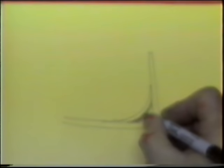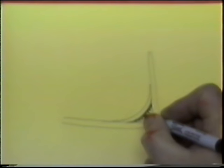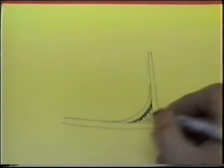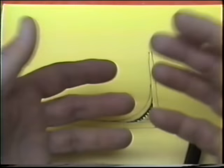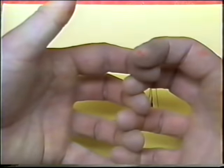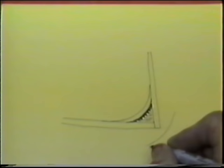And the company that makes aeropoxy recommends 80 grit paper when you're going to do an epoxy to an epoxy lamination. What they recommend is waiting 48 hours for the first coat to dry, so that this, in essence, is totally dry. See, with epoxy, you have two choices. The choice one is if it's still pliable and soft and like peanut butter, and it hasn't dried yet, you could trowel the next coat right on, and it does this on a molecular level, so you get a good bond. But once it skins over and dries, it has a hard skin. Then you have to break that skin.